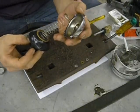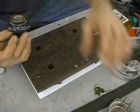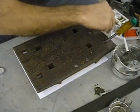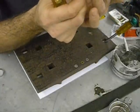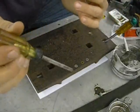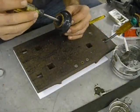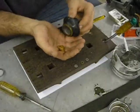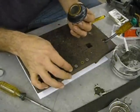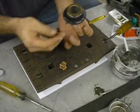All right, here's a diaphragm out of the bike. Put the cap aside. Spring. Here's your main needle — it's got a small spring too. It looks like a Phillips head. Release it. And there's the culprit right there.